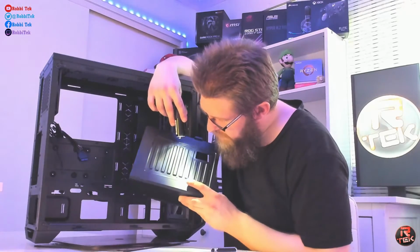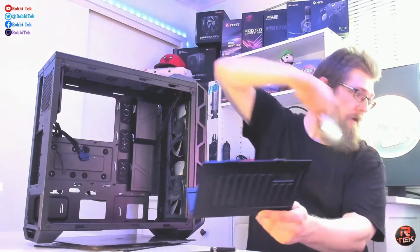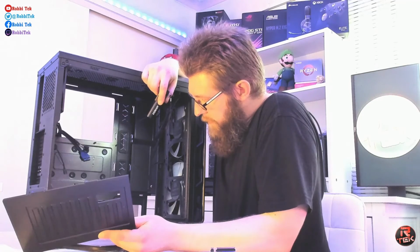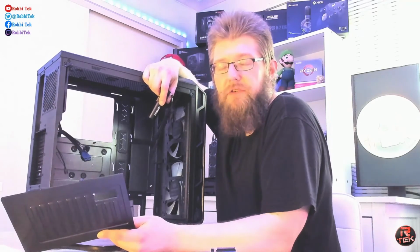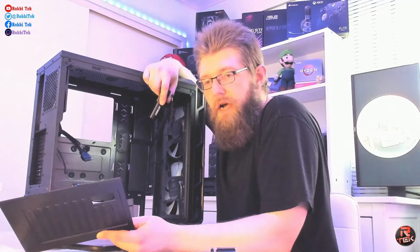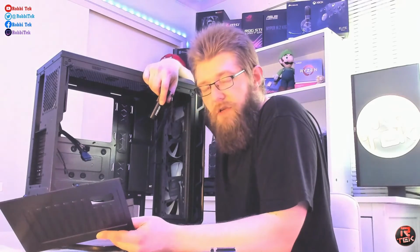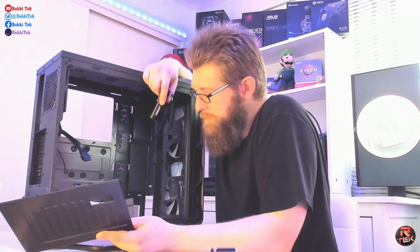It seems to be a blemish hole, like right there. So the question is, the power supply I have is quite nice eye candy, frankly. It may be an option not to cover it up, depending on what I've got around it. At the moment I'm utilizing a 1050 Ti, and I do need a new graphics card in that workstation PC. If I had a more heavily cooling-reliant graphics card, then I would definitely have the power supply facing downwards, but there won't be too much heat generated from that graphics card in this system. So pulling some of that heat from inside is slightly helpful.